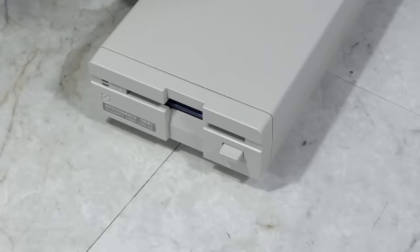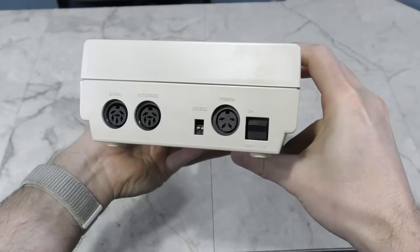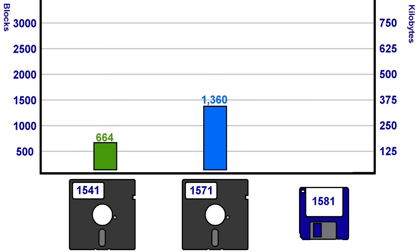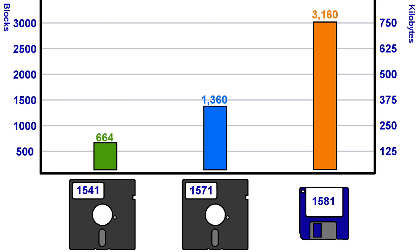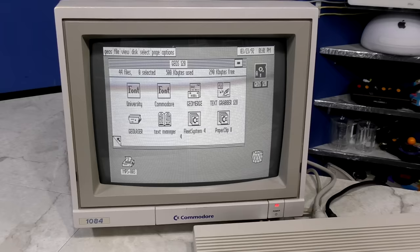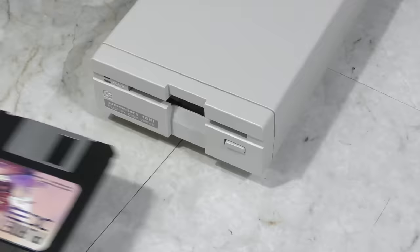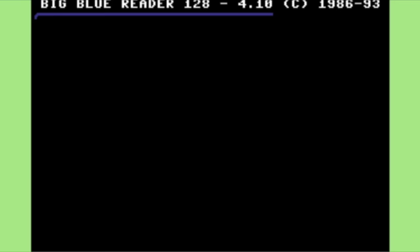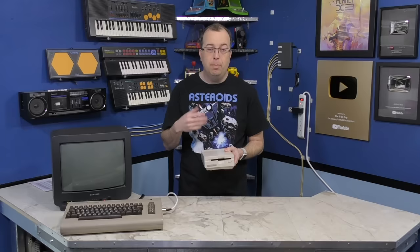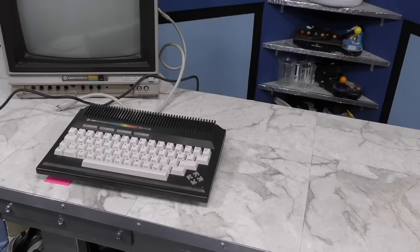The 1581 was introduced in 1987, well towards the end of the 8-bit era. This drive uses 3.5-inch double density disks. Because very little Commodore software would ever be distributed on this format, the main benefit of this drive was that it had a lot of storage on a single disk. A freshly formatted disk would have 3,160 blocks free — a colossal amount for a Commodore machine, roughly 5 times what you could store on a 1541 disk. As such, these were popular with BBS operators, often having more than one of these drives, giving their file transfer section a lot more files to pick from. They were also popular with people who used GEOS, especially GEOS 128. They supported burst mode so they were very fast, and they could also read MS-DOS formatted disks just like the 1571. Despite not being directly supported by any games and virtually no commercial software, they were very popular with hobbyists and BBS operators and power users, and therefore these are highly sought after today and tend to fetch top dollar when they show up for sale.